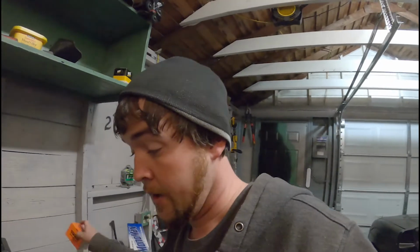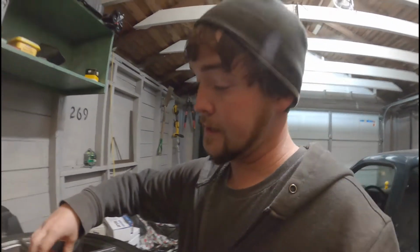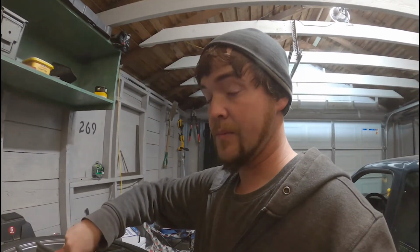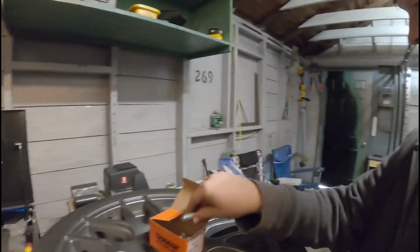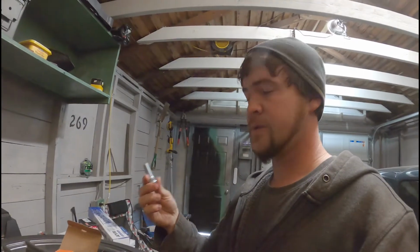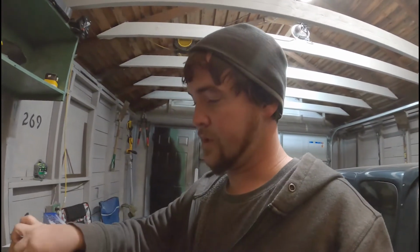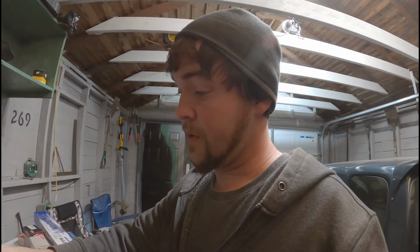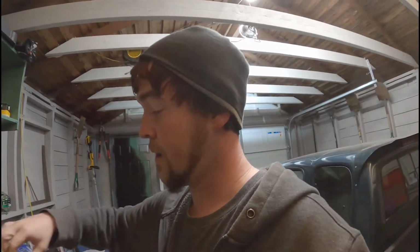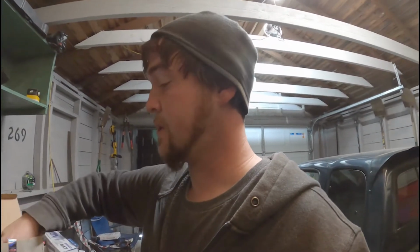Now, the other thing that happened was that the studs got stripped out, so I've got some new studs here. I actually have another box of them over there. Supposedly the 4-wheel drive Tacoma has longer studs, so if I'm already in there, I'm probably just going to do all 10 of them, although it's a bit more work than it looks like. Also, when I was looking in there at the track, I realized my upper ball joint was split. We'll take a look at that.